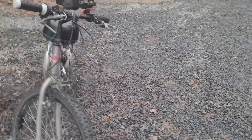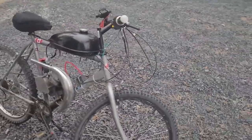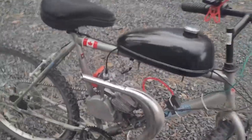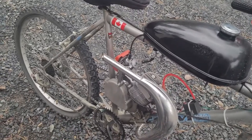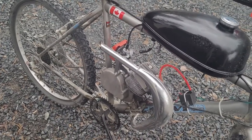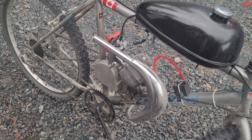Now, I've tested these up against the WC80 and Bikeberry Deluxe. They give more bottom and mid-range power. The Deluxe pipe gives a little bit more top end. How he runs this bike, I assume this is a pretty good match for a decent price. Most of the power gains from this pipe is from the simple fact that it's opened up and less restrictive, but the expansion chamber from my testing does do a little bit for the bottom end.